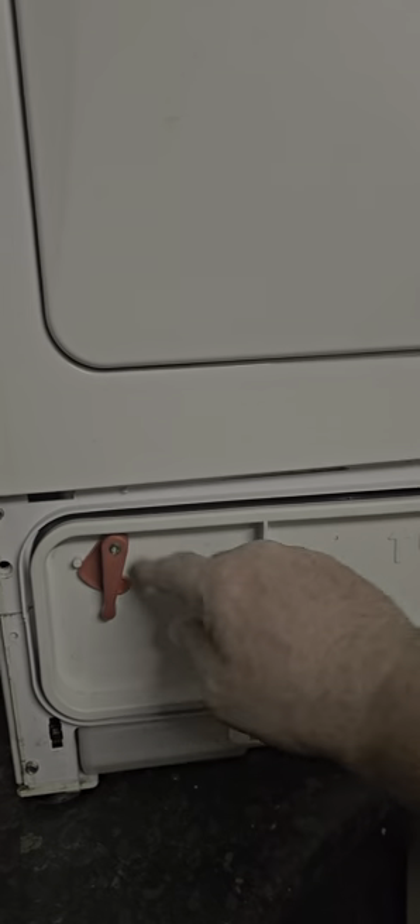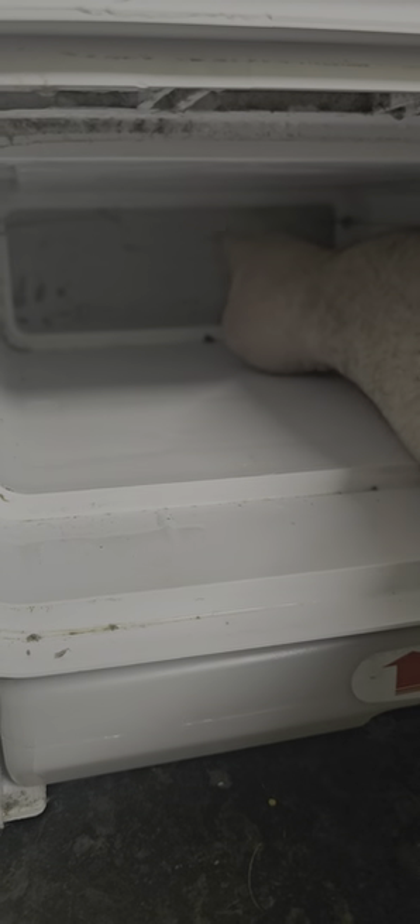You want to take out the condenser like that, and if you go right to the back here, down there, there's a hole in the floor. In that hole in the floor you'll feel lots of lint and crap in there. Clean it all out — get yourself a dry sponge, try and sponge it out to get all the water out, make it nice and clean, and then see if the machine starts to work again.